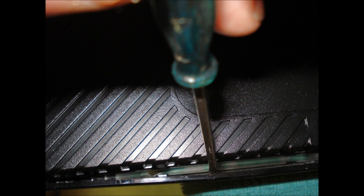To remove the back cover, remove the stand first. Insert a small screwdriver in and around the bezel and pry out lightly. Only apply enough pressure to dislodge the tabs from around the bezel. Work your way around the outer edge of the bezel until the back is free.